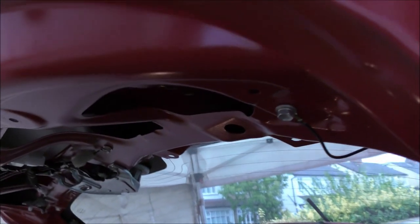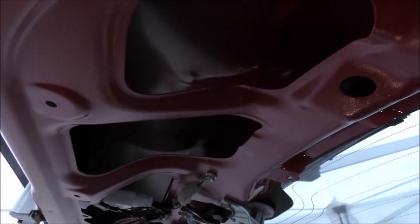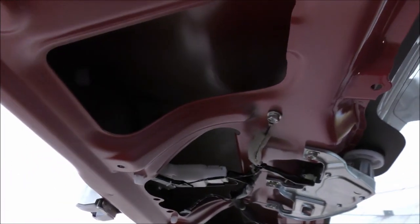So as we open up and look on the inside, we can really see it's nice and open in there, so plenty of room to get the tools in. And as we come around to this other angle around the other side, you can really see the impact point just there, that sharp point where it's almost punched through the metal. Now, there's no way I'm going to get that bit perfect, especially not with that paint damage. So we're just going to work around the rest of the dent and do an improvement there.